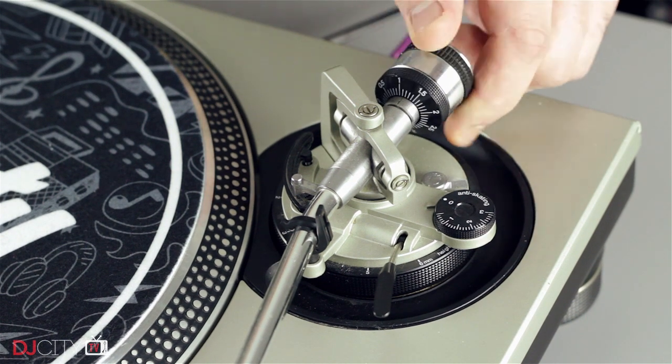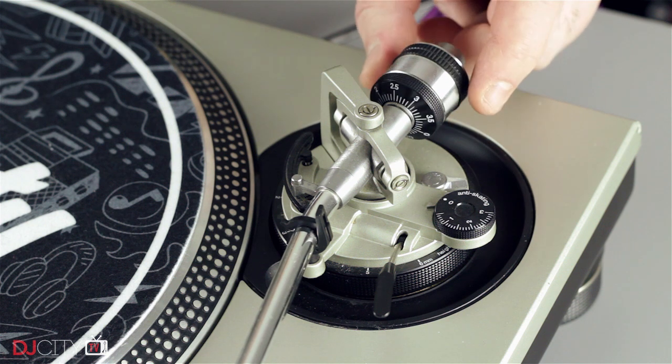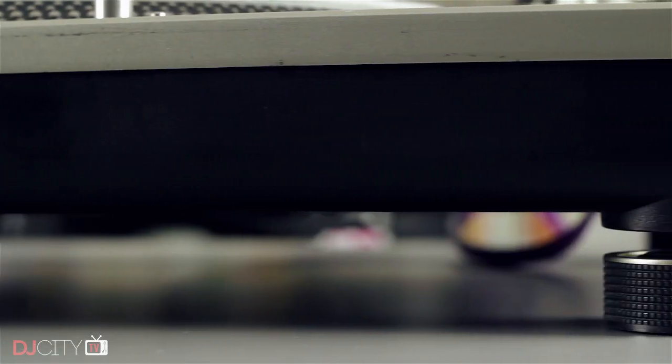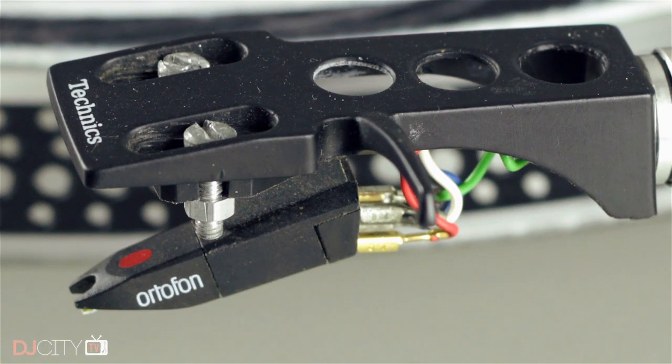The direct drive motor was patented at the time of release, and that gave Technics a huge advantage over other decks for DJing. Having the platter itself incorporated into the motor meant vertical movement was limited in a way never seen before — another reason why the 1200 was for so long the ultimate deck for the new scratching techniques being developed by hip-hop DJs.